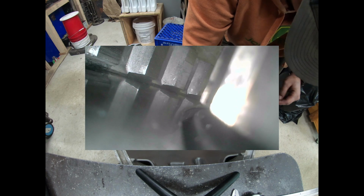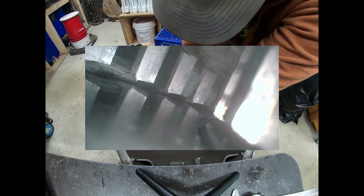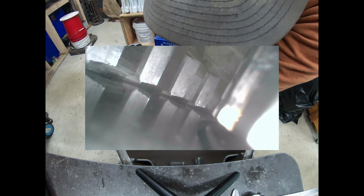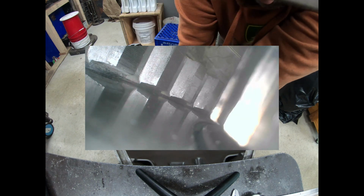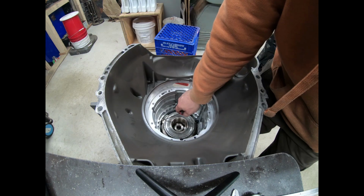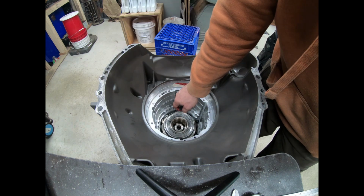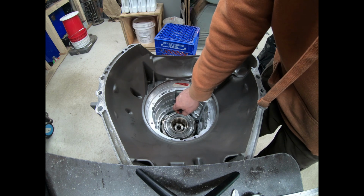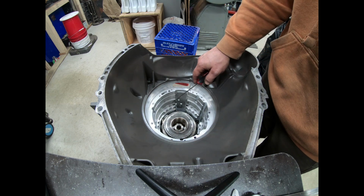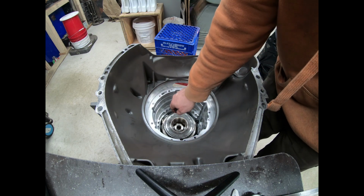Now on the inner diameter here, it's hard to get, but there we see, there's the outer race right there. Now you can see that there is a height that we need to go above that 1/8 inch steel before we engage those splines. So those are 2 things we need to worry about. So that bottom steel, I've already measured this. There's some thousandths underneath this spline here. So if our steel was that many thousandths thick, it would not engage.